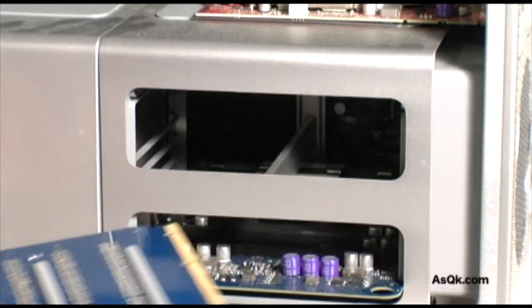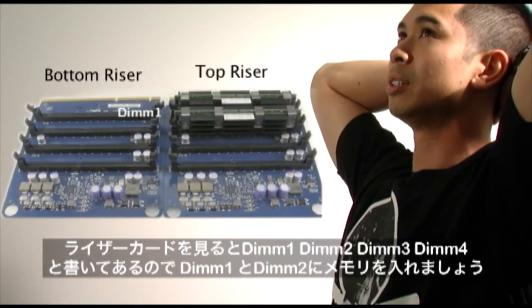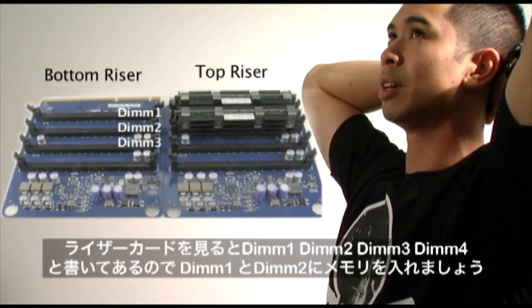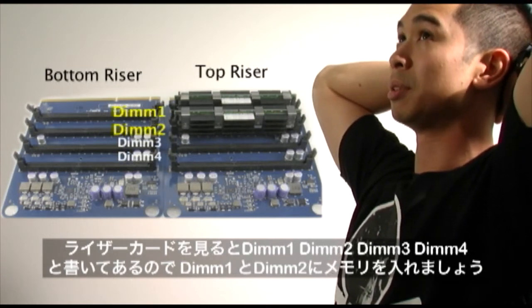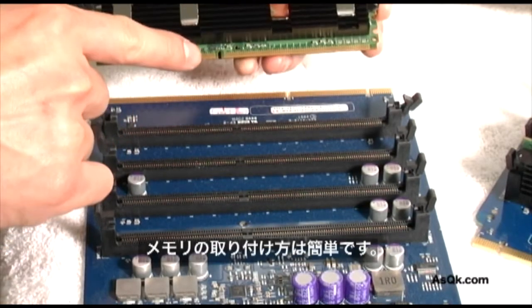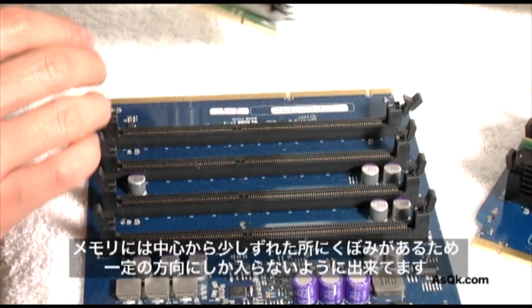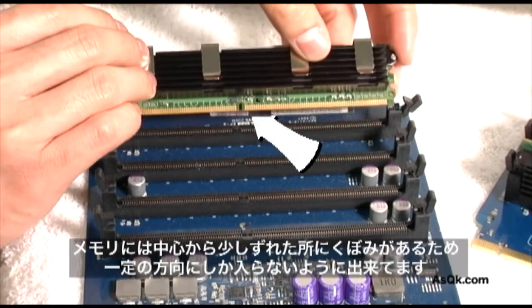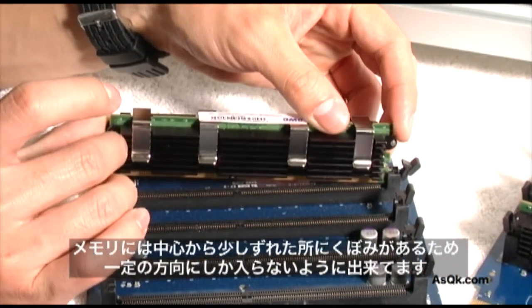After you take out your memory panels, you're going to see them labeled DIMM1, DIMM2, DIMM3, DIMM4. Make sure you install your new memory cards into DIMM1 and DIMM2. Installing your memory cards into the DIMMs should be no problem — they should fit right into place. There's an off-center notch that will tell you if your memory card is in the wrong way.